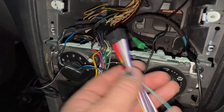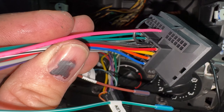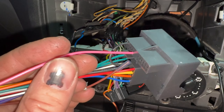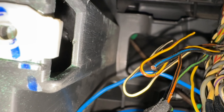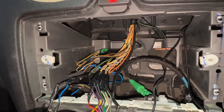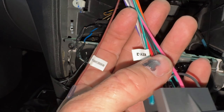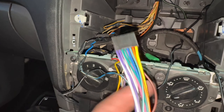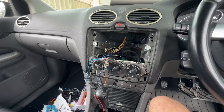You've got two different types of connectors here: the bottom is typical of your ISO type connector, the top one is typical of your CAN bus connector. That blue and striped black wire could very well be part of CAN bus. Usually there are two key wires — Key 1 and Key 2 — so the orange one may actually be Key 1. Not 100% sure on this head unit, but we'll find out pretty soon.